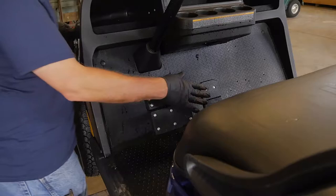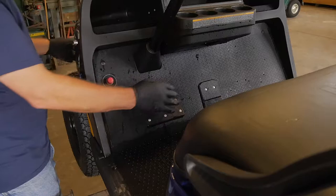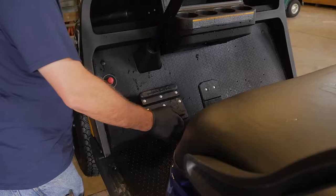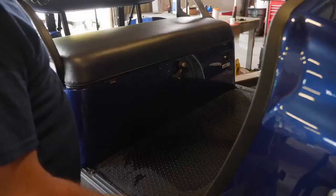On your brake pedal, there's a parking brake lock at the top edge. You're going to simply press the top of that — press it until it clicks. That is your parking brake lock. You want to make sure that your pedal will release that parking brake, or you can press the bottom part of the pedal itself to also release the brake. You want no binding, and you want to make sure that that parking brake locks and holds.